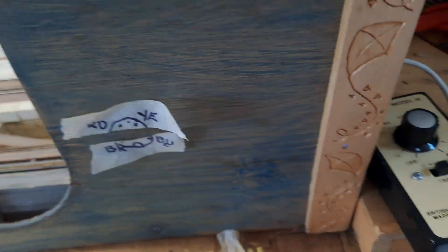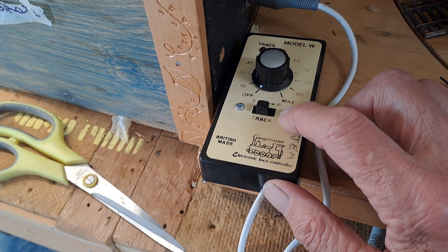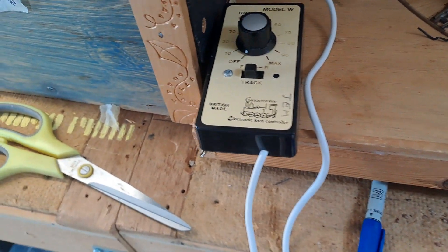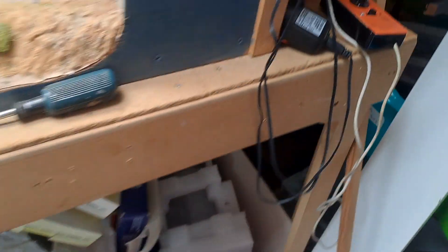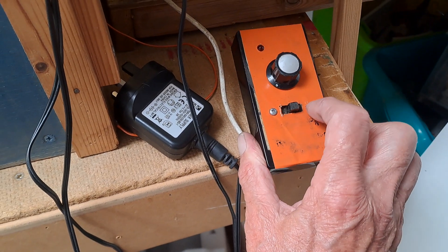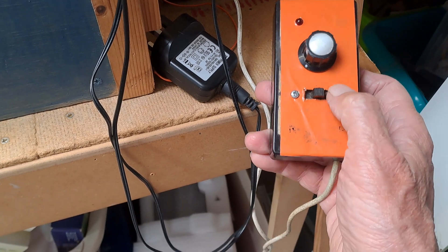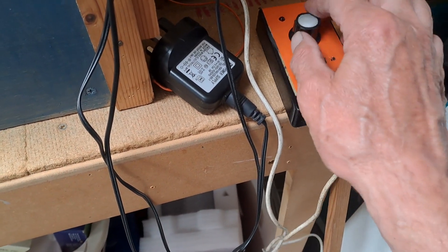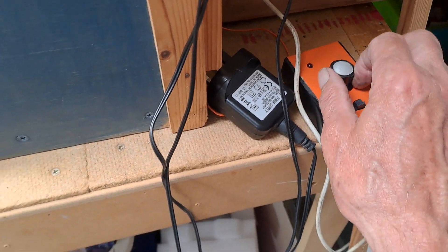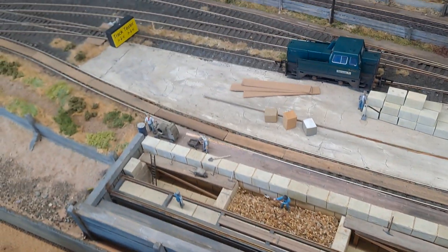And then there was cleaning of the track. This side is wired correctly now, so that was rewired. There's one screw in each of them, because the two screws in the old grubby one had to be removed by grinding them off with the Dremel — and that was a lot of fun, finding the right grinding bit and cutting discs. I had to cut the screws off because they were completely rusted and it was a bit rusty inside. But now it's functioning okay — you can see the light coming on to indicate there's power. Rewire the plug and it's fine.